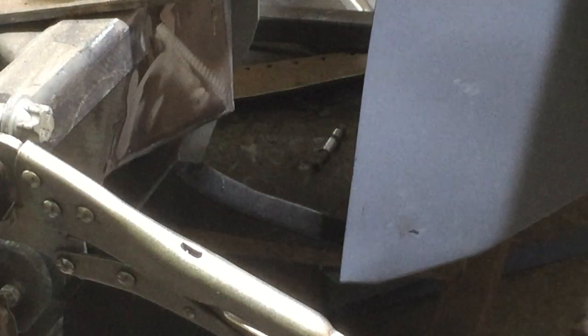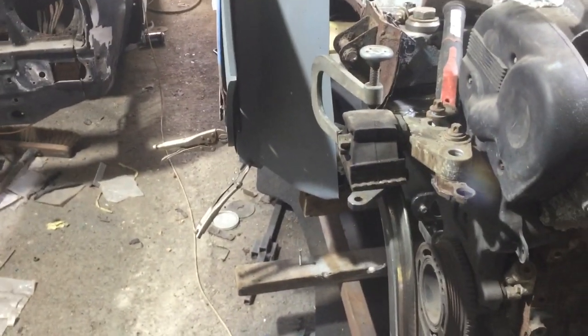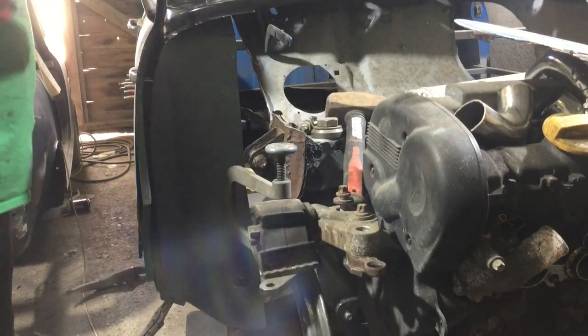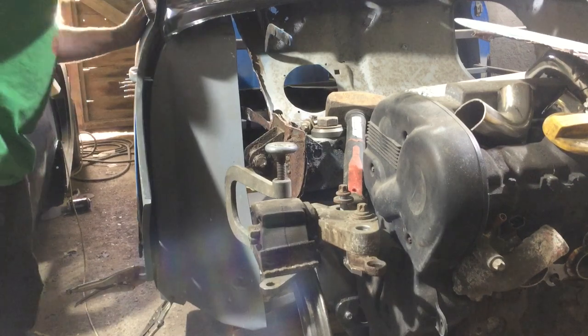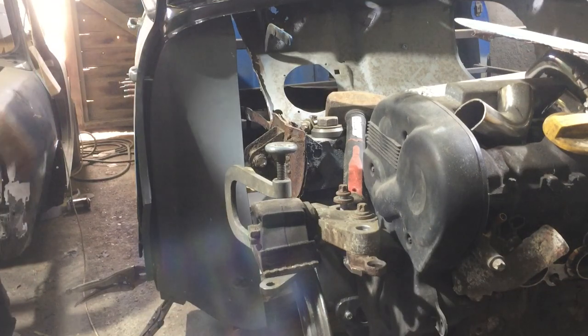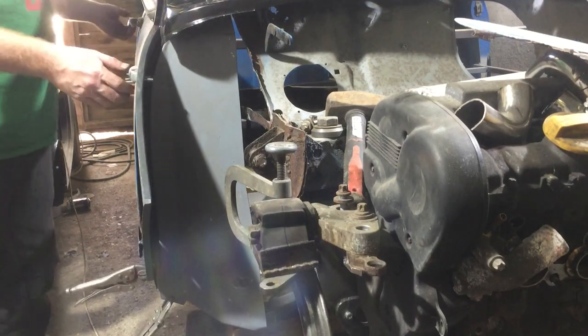Other things are lining up though. Obviously in the end I'm not going to weld anything on until I've even got the front end and wings on - it would be silly not to wait. I'm also thinking I might just need to pull the pillars in a little bit, double-check the measurement across for the window. Somebody put a strengthening bar in there but they've only put it where they cut so much out - it's holding a bit of the panels together but it's not stopping the whole body coming apart. We're getting there though.